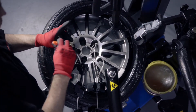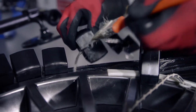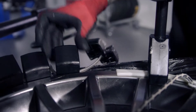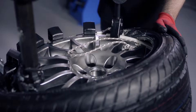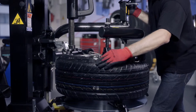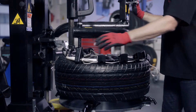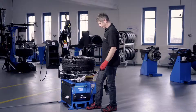If the tire has hard sidewalls, also add the smart bead spacer tail. Make sure not to compress the belt edge and support the triangular bead pusher with the hand. Continue mounting and gradually release the pressure exerted by the bead press arm in order to relieve the bead as much as possible.